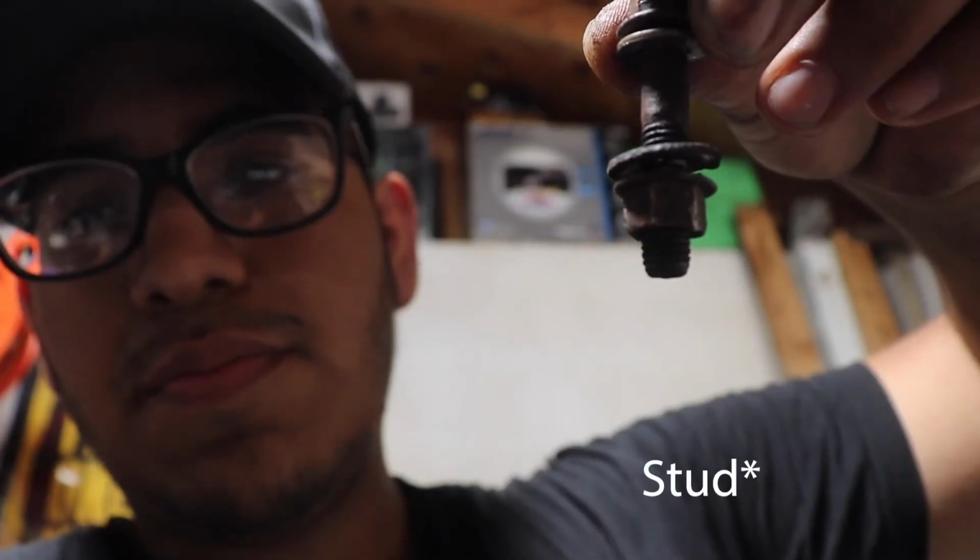They're actually 2 different sizes. One of them is a 12mm socket, deep socket, but you're gonna need the deep socket just to get through, because as you can see, this bolt is pretty long, so you're gonna need a deep socket to get through there and to the bolt. So yeah, guys, again, you're gonna need a breaker bar or something of that sort to give you leverage, and maybe a second person to just give you a hand holding on the top bolt while you're under and unbolting the bottom bolt.